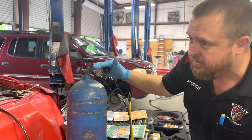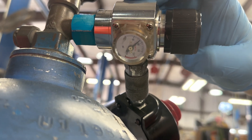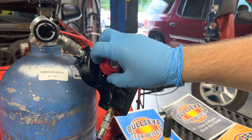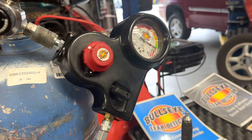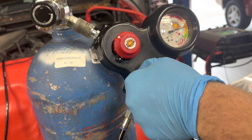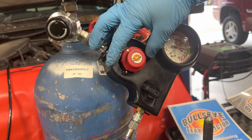We start with the high pressure gauge setting. On this little gauge here, you want to preset that at 80 PSI. Once you get this gauge set at 80 PSI, you've got the EVAP gauge set up here, and this is what is going to regulate your pressure to the EVAP system. You do not want to put more than 25 inches of water into the EVAP system, so we set this gauge to 25 inches of water. You want to make sure we've got all the air pockets out of the system — Bernie recommends opening that valve twice. You can see our needle didn't go all the way down, so we reset that at 25 inches.